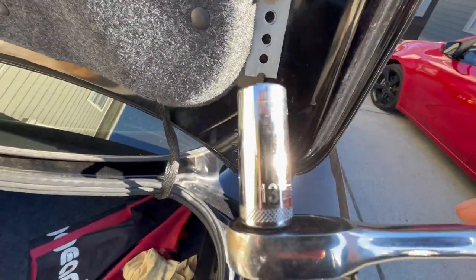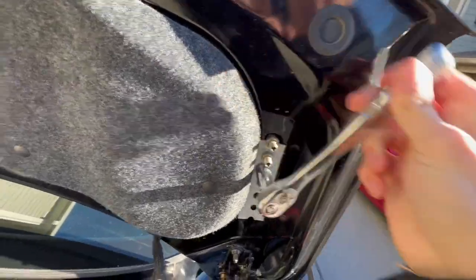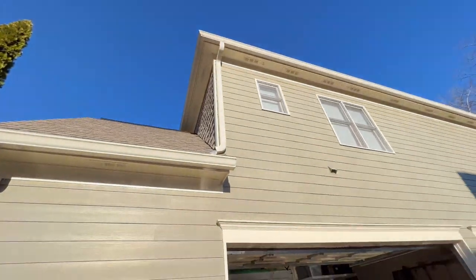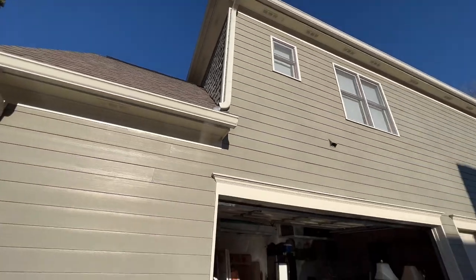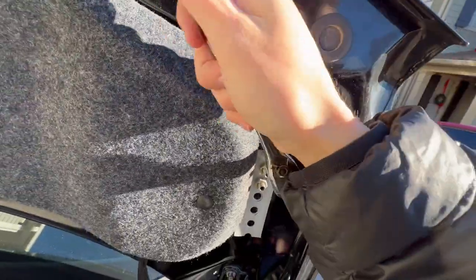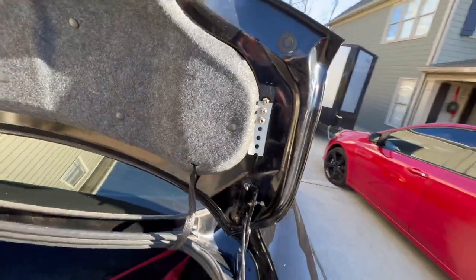But anyway, come over to the toolbox right here. For those of y'all who are doing this at home, doing it yourself, it's a 13 millimeter socket. Goes right on there. These are not even on there tight. Interesting how that froze, but this didn't. Anyway. All right, these can just be hand loosened now. So I'm gonna loosen these and then I'm gonna pick the video back up.